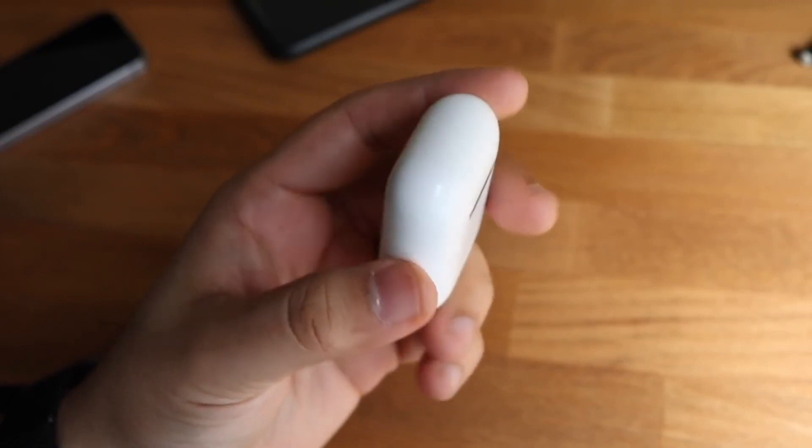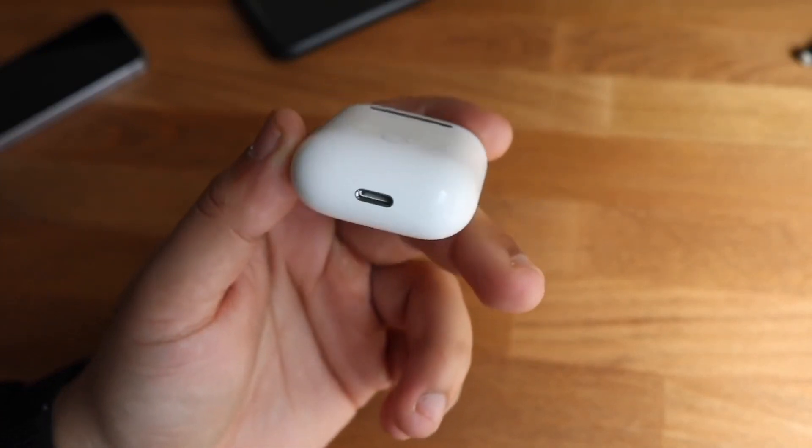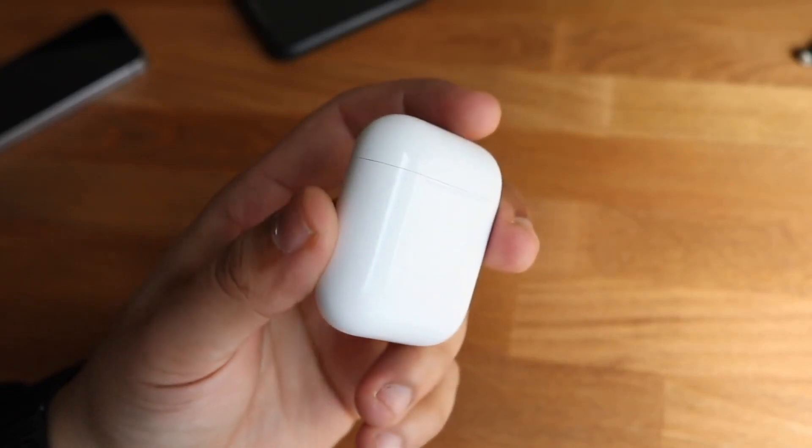Most of the time a lot of people actually have this enabled, so turning it off may be the best bet if you're using it on your iPhone, iPad, or any other device. The best thing to do is check your settings app and disable iCloud Handoff.